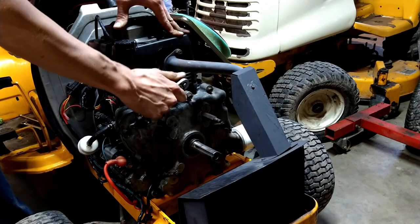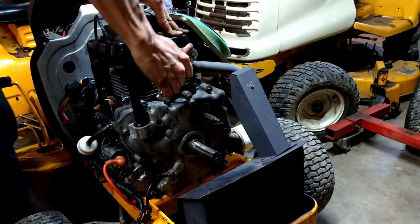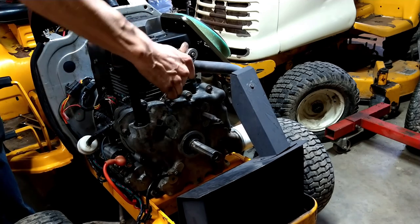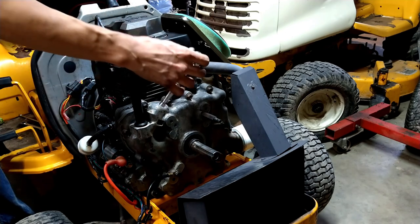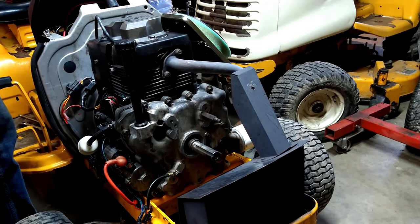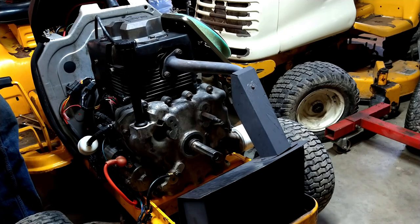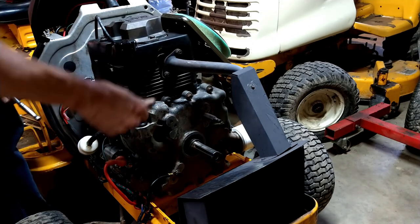You see, I'm using a quarter inch ratchet for all this stuff. I'm probably going to go back through all of the bolts and make sure everything's tight, with the exception of the drive shaft. I know that was nice and tight, but any of the external bolts, I'm just snugging them with a real small wrench so I don't snap anything, and then if everything looks good, I'll probably come back in and actually make sure everything's super snug.